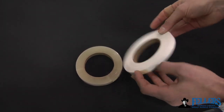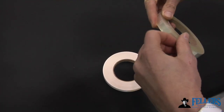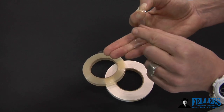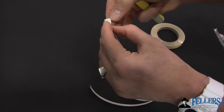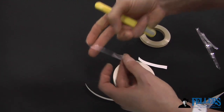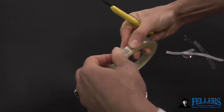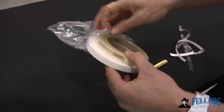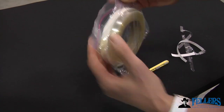This is a close-up overview of the 3M Edge Seal Tape. The white is the matte, the clear is the gloss. Each roll comes with a little sliver of masking tape — always try to keep that for the end. You release the liner and expose the adhesive; never put your fingers on it because that can leave fingerprints, so always try to leave the liner on as long as possible. If you release the entire liner, because of the thinness of the edge seal and the aggressiveness of the adhesive, if it folds on itself it's impossible to get apart. When you're done applying, take that sliver of masking tape or cut a new one and reapply it to the edge — otherwise it'll unroll in your tool bag. Then put it back in a sandwich bag and seal it completely to keep dirt from building up and to keep it safe.